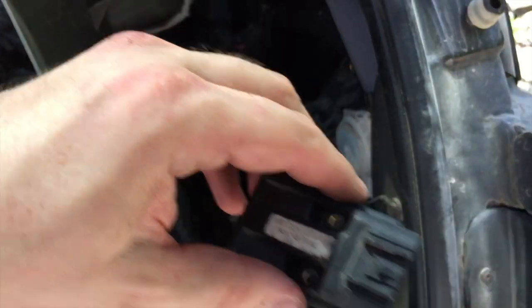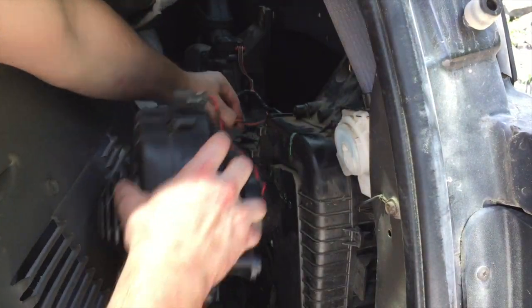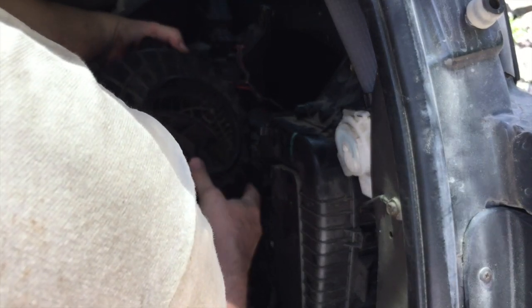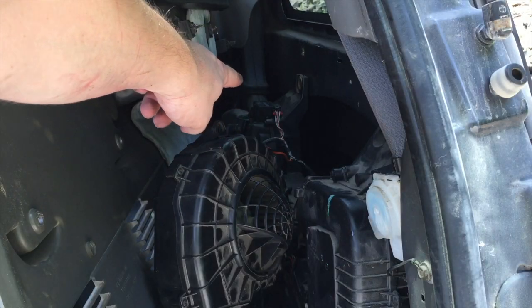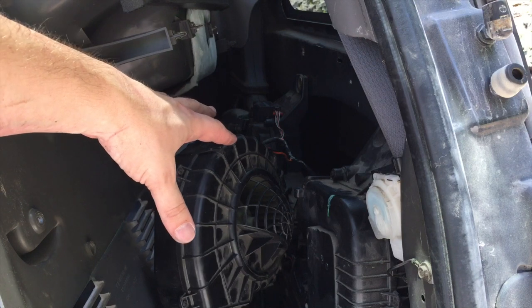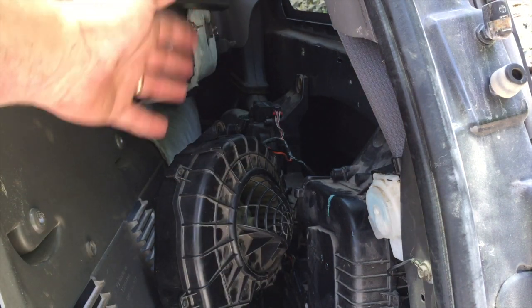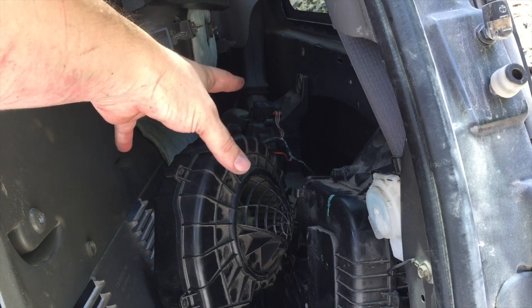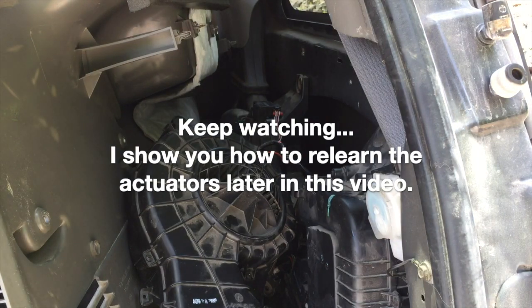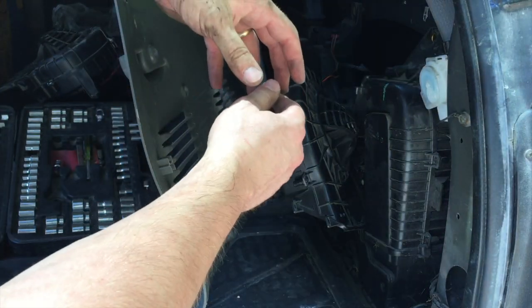Here's the module from the parts Trailblazer — I'll snap this into place and temporarily plug everything in. What you hear is that actuator on top making noise. I pulled all the HVAC fuses trying to figure out what fuse did what — everything checked out and had power. But on Trailblazers, whenever you disconnect a fuse or drop battery power, these actuators are notorious for getting out of whack and need to be relearned. Still no fan though.